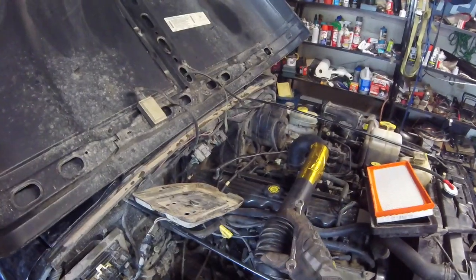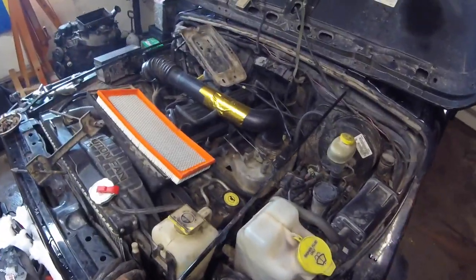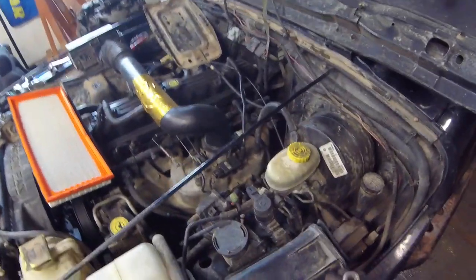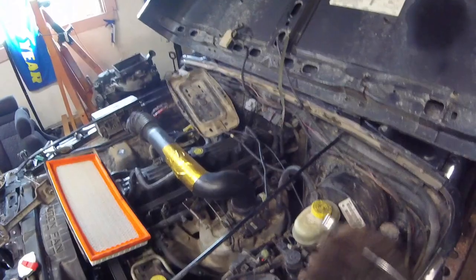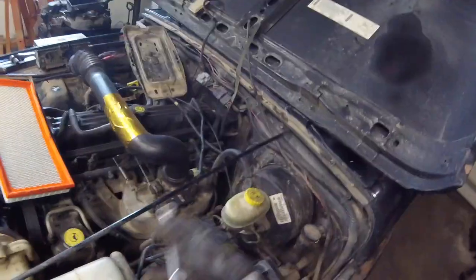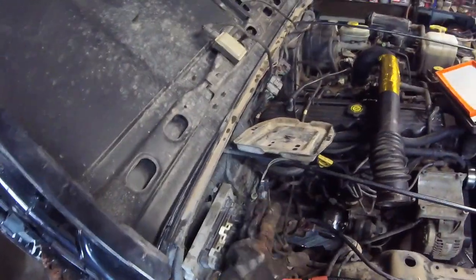Just like the warning about cutting the hood — if you're not willing to do a cold air intake, a direct snorkel, or a cowl intake, then this mod is not for you. You have to delete the air box. You're also going to have to come up with a lower profile option for this component, whether it be moving it down the fender or something. There's a way to delete the system but keep the sensors and one tube in a loop so it still passes the vacuum leak test, and it's just one of these two modules.